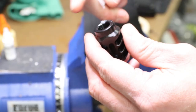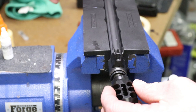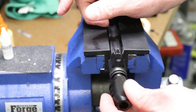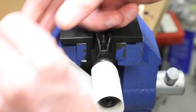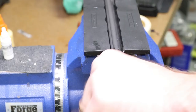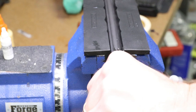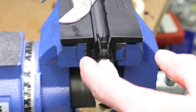We'll get a good amount of Rockset on there - I always like P for plenty. Then we're going to put some synthetic PTFE grease right there on the backside of the brake - it just helps since we're crushing steel on steel on steel. Get those threads started. We're pretty much all hand snug at this point. Wiping off any excess grease, throw the tape on there: four wraps, and we're good to go. One, two, three, four. Grab our 13/16 wrench. We're basically at that maximum again - 540 degrees maximum crushing.